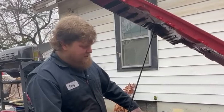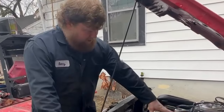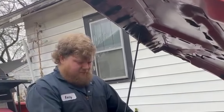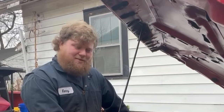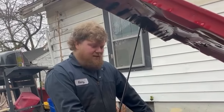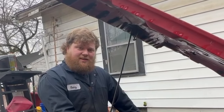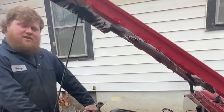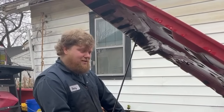There may be a rear gear change in this. I don't know if I said in the beginning of this, it's a 350, a 60 over flat top, aluminum heads, it's got the air gap intake on it, a Comp Cams big mother thumper in it, springs to match. The heads have stainless valves in them, 202 160s, they're basically a Brodix knockoff from China, got them on Amazon, super cheap, they work pretty good. This motor makes decent power. I had it in a full size, single cab short bed C10, and it threw that truck around pretty good. So I'm expecting it to perform pretty well, especially since I'm upgrading to the Sniper EFI. Should have plenty of response and be a lot better than it was on my terrible carburetor tuning job.